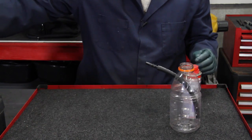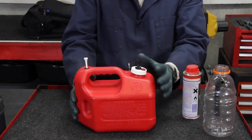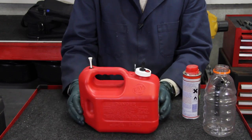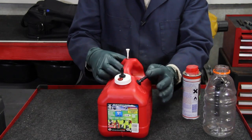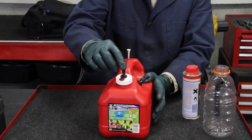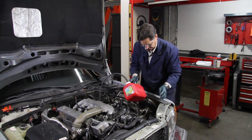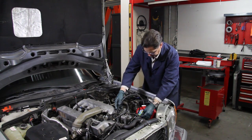Then followed a larger fuel tank. I thought the bottle had some restrictions, so why not come up with a tank that had a lid on it where I could get a little more diesel purge in it. I began to think this could become a troubleshooting fuel tank as well as an emergency fuel tank. The problem with this tank was you had to get all these connectors — a return line, a vent hole, and an outlet — and the more I tried this on different cars, it was very difficult to fit. In this 300 SDL you had to work around finding a good place for it, and in some cars it would literally not fit.